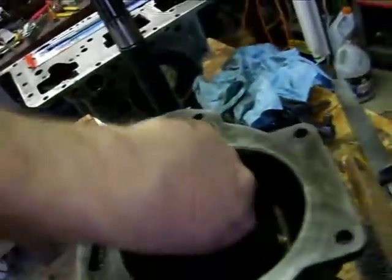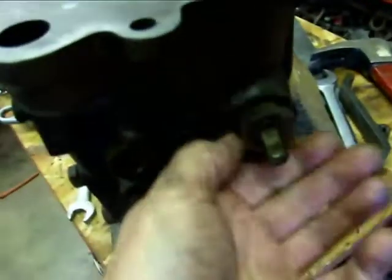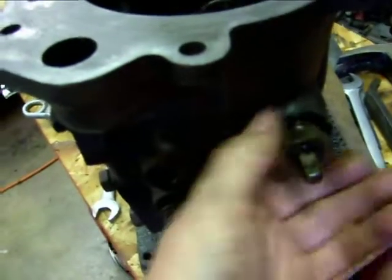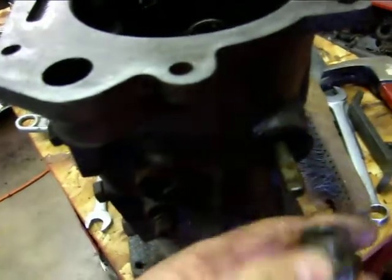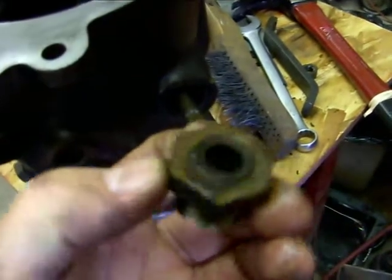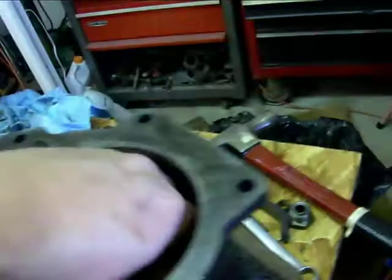Flip that up and out of there — that's all going to hang together. I'm going to take this nut off and lock washer, get the lever off. I've already loosened this stuff obviously. I'm going to pull this out of here. And there's your seal — that's definitely an area that's going to possibly leak.